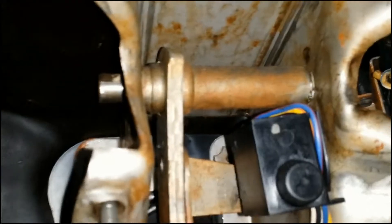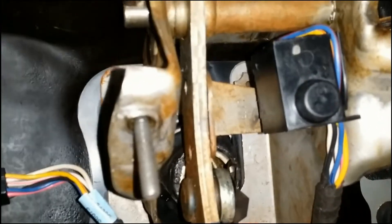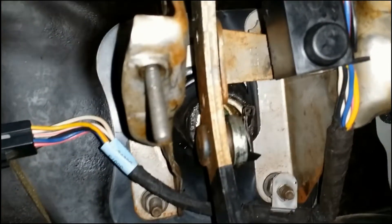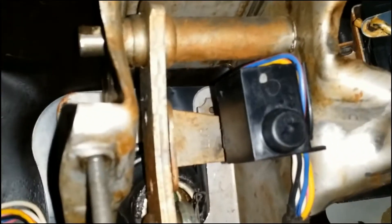I've also installed the pedal. Up here on the pedal there's a cross — this is the axle I was talking about earlier, right in here. There's a nut over here, I think it's a 15 millimeter. I installed that and at the same time I replaced the clip I showed you earlier, right in here. Then there's a brake pedal sensor that bolts onto the back up in here. So that's been installed and now the brake pedal is somewhat working. Still need to attach the entire steering column — it's still laying on the seat.